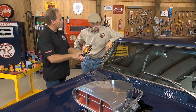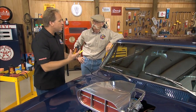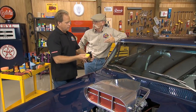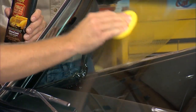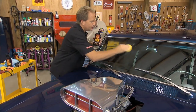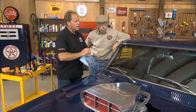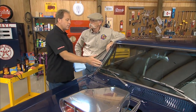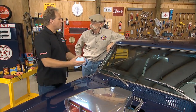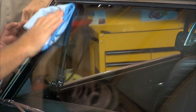So now we've got that clean, but we're not done yet. The next thing we're going to do is put on the Pinnacle Glass Coat Window Sealant with Rain Repellent. What this is going to do is seal all those microscopic pores and create a hydrophobic surface — that means water-fearing — so water's going to want to get away from that glass. You're not going to use a machine on this; this is hand-applied. Just come down and really work this into a nice even coating over the glass. Normally you would let this dry 10 to 15 minutes, then wipe it off, and you could add a second coat for uniform coverage to make sure you got every square inch covered. Anytime you use your wiper blades the water's just going to clear quickly, your blades will last longer, and over about 30 miles an hour the water's just going to fly off. So I'll go ahead and wipe this off — this is the abbreviated version.